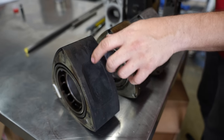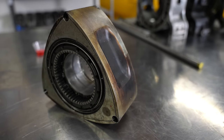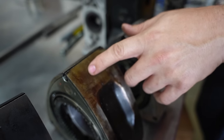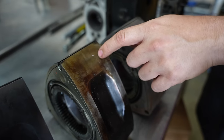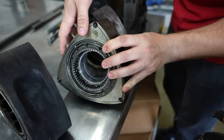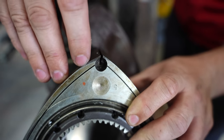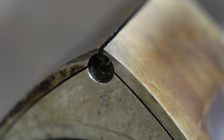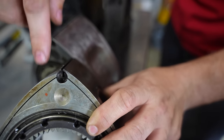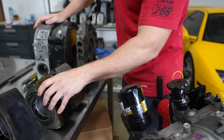There are a couple of major causes — one of them being coolant getting into the engine, as well as regular gas. This other rotor — you would think the denting from detonation is the problem I'm pointing out, but that's actually not as big a problem as you think. The thing I brought this rotor out for is a very small issue right here: that little edge of wear. That means this engine was wobbling and the rotor actually touched the housing — they kissed — and that is not good for race engines.